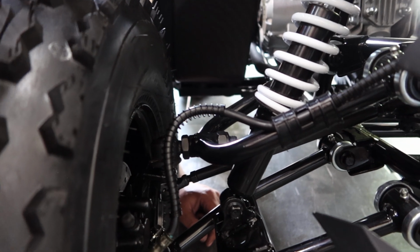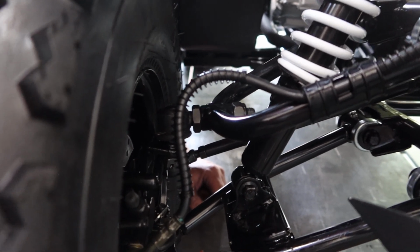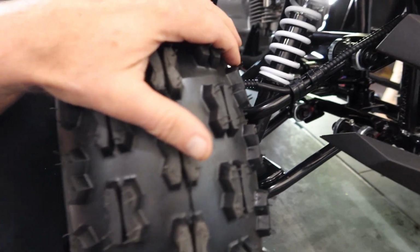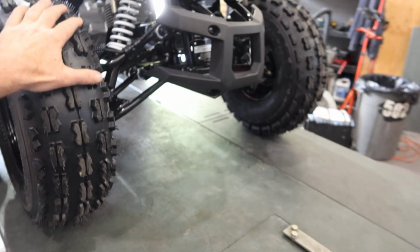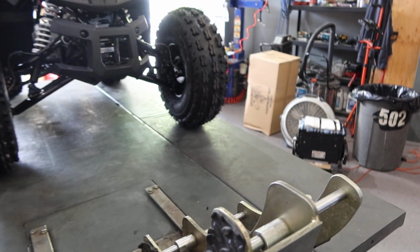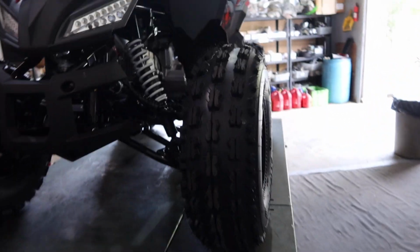Very important. Now, we do have a video on how to do that on our channel, so look for it under ATV service, how to do the toe and camber adjustment. This ATV being a premium, it does allow you, a lot of the other Chinese ATVs out there, they don't have a camber adjustment, they only have the toe adjustment. Now, the toe adjustment, you guys, would be the tie rod here on the inside. And what does that take here? Where my hand's at, right over here. It takes a 14, two 14s. You're going to need one to hold the center and then loosen the two nuts.